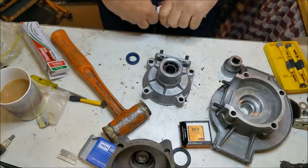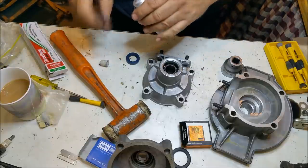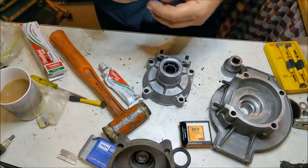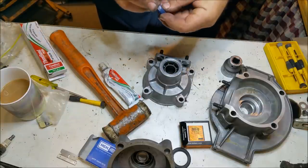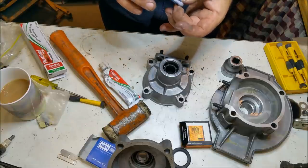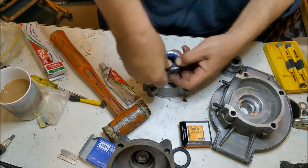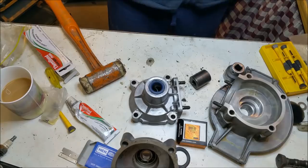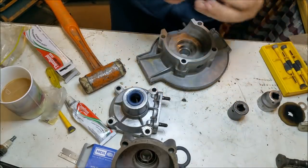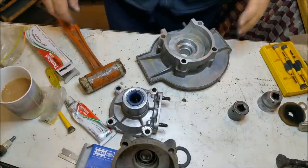Yeah, if I can get the lid off. This is the equivalent of Honda Bond, same sort of thing. And theoretically speaking, it's not necessary, but it will help the seal go in. We'll just finish it off with the socket. Now this seal goes in from the inside. There are two, there's the 6204, and there's also a smaller seal that goes in there.